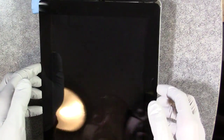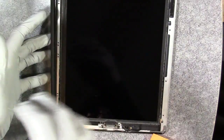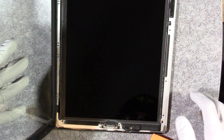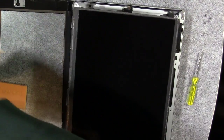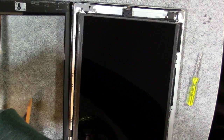I got this digitizer off. You want to be very careful because of the ribbon cable holding it on the bottom left side. Just go ahead and flip it open like so — it's a very tight fit for the ribbon cable. I have this tool here that I got from iFixit.com. I just really like their third-party products.